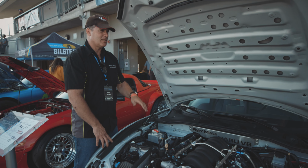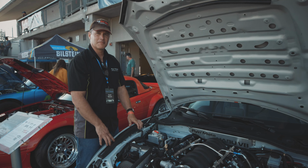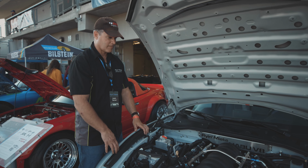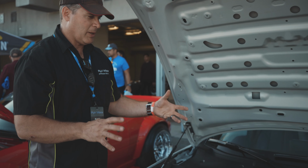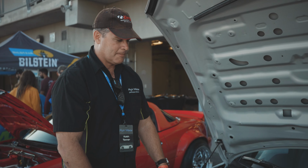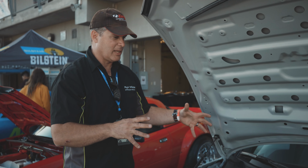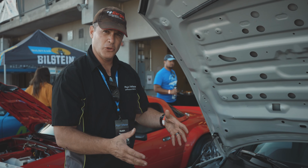It's cruising at 1,800 RPM and in the high 20s, low 30s for fuel economy. Cool. What's the weight difference between the stock engine and this swap? The weight differential on this thing, it picks up about 250 pounds over the stock setup. The weight balance is about 1% further on the front. I think it's 53% on the front instead of 52.